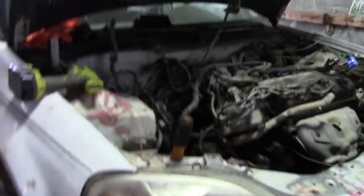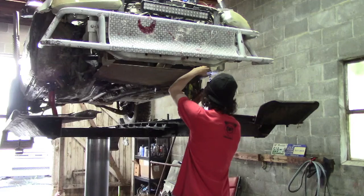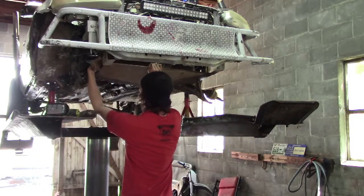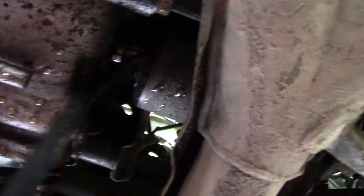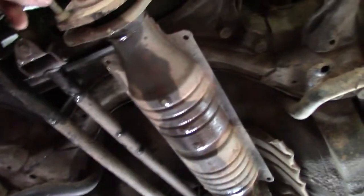When we hopefully are pulling this out, I'm gonna go ahead and lift the car up and get this skid plate off and see if we can't pop those axles out. Now the skid plate's out of the way, I can get a little bit better angle on these axles — there it goes. Really all that's left from here is the shift linkage and the exhaust right here.